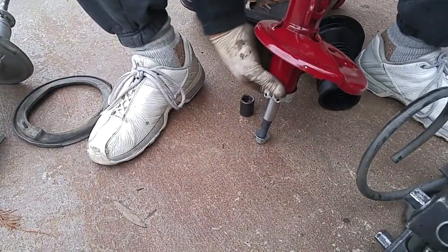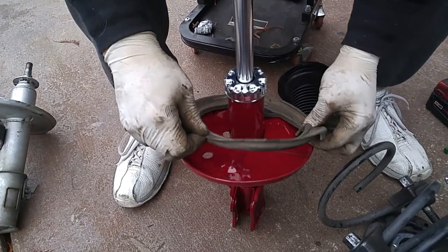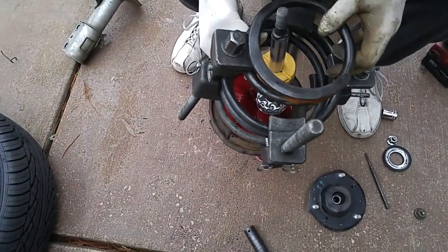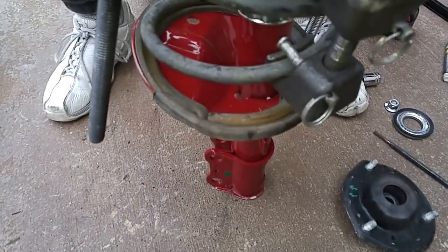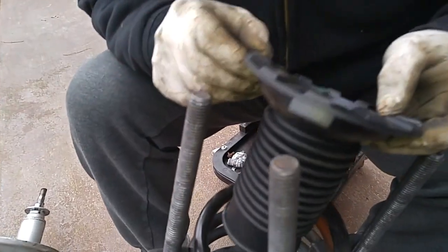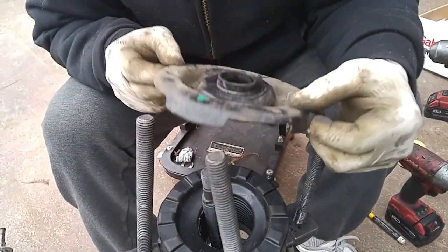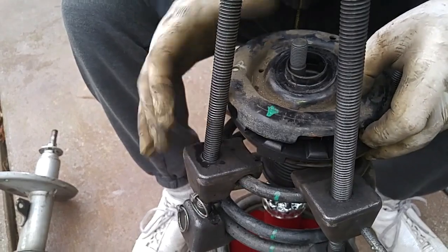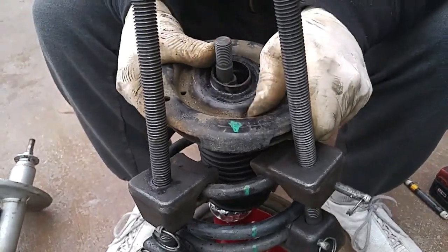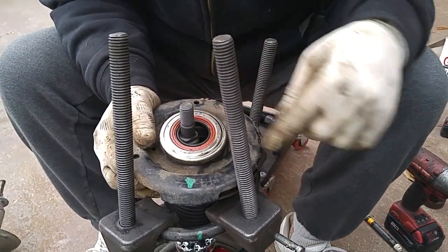This is the retainer for the shaft. Now the shaft is going up — take this nut off and put the lower spring seat insulator. You can put the spring now on the strut; make sure it's lined up right here in this little notch. There's an arrow on the new bellows — I'll put a paint mark here so this arrow on the bellows lines up with the green line. This is the upper spring seat; we'll line that up with the new bellows.